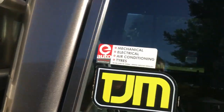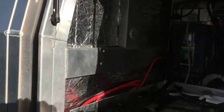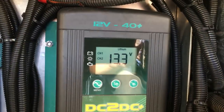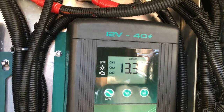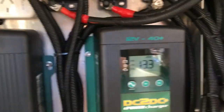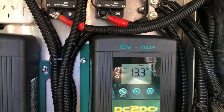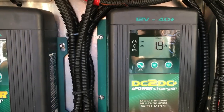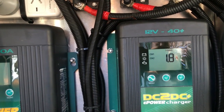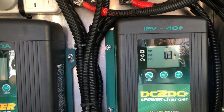Just hit the key and we'll see what sort of happens. Like I said the battery is probably only down to 90% overnight. You can see there that the DC-DC has kicked in as soon as the car started up. You can see it comes up pretty quick — currently the battery is at 13.3 volts, not fully charged. Looks like it's putting about 19 amps already, and the car is just idling.